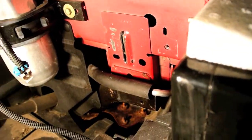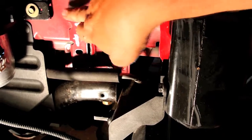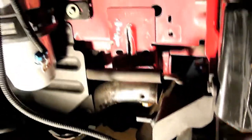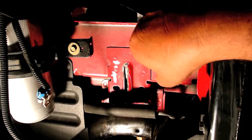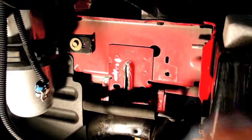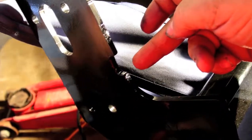I've got this cleaned up about as much as I can. If you see right there in the center, there's another piece of metal which means the plate doesn't lie flush to this, so I'm actually going to have to put a few washers here and there. One nice thing though is right here on the bottom side - two bolts will go into this, and this is the actual frame that goes to the engine. It's not very thick on top - like two pieces of maybe 1/16th to 1/8th inch steel - but down here it's an eighth inch to a quarter inch of steel, so this is much more substantial. I'm going to paint this with a little Rust-Oleum and then do the other side to make them equal.